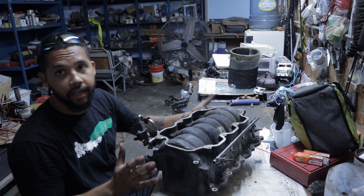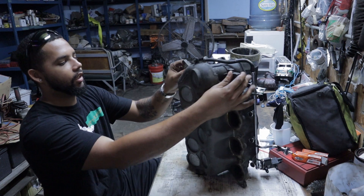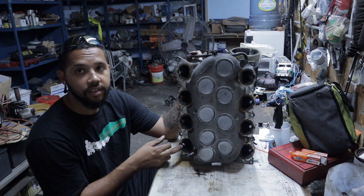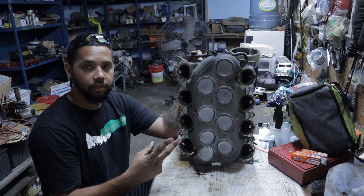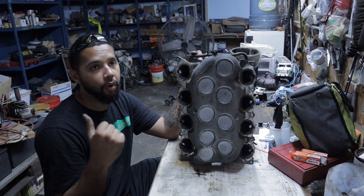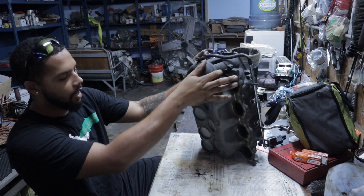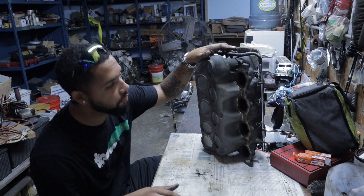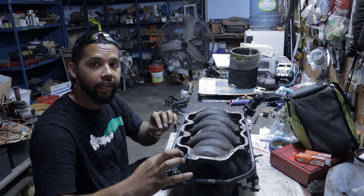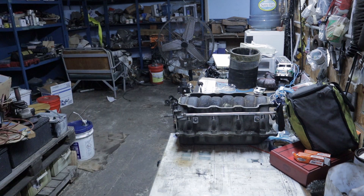Now you're going to need the lower intake from the motor. This is a very important piece because you're going to need the fuel rail that comes factory with it, and also because when going from B heads to C heads you cannot reuse your B head intake manifold. The port design was changed — B heads have a smaller dual port design, two ports per cylinder, while this is a single port per cylinder, a much better revised design. This gives you more peak horsepower and torque and should be good for boost as well. Make sure all the plugs are in the bottom and that you get the fuel rail with it.